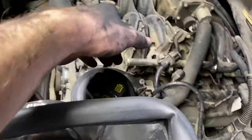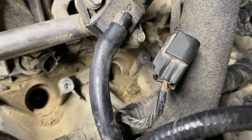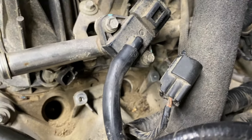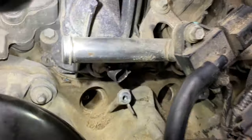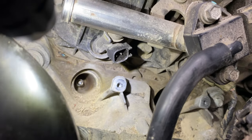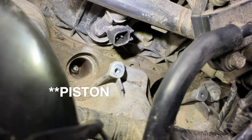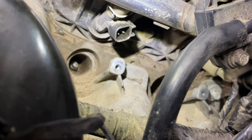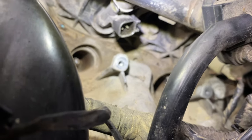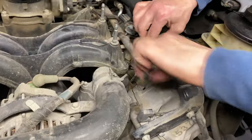Dustin had a vacuum with a tube and was cleaning up. You can see how much buildup there actually is on top of the spark plugs right there — there's your tip of the plug and you can see how much buildup is down in there. We're trying to keep that from getting on top of the cylinder head — that's not good stuff to be in there. So we're going to clean all that up before we pull the spark plugs, get it as clean as possible, and then jump into pulling the spark plugs.